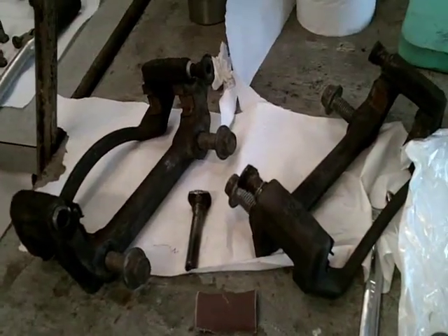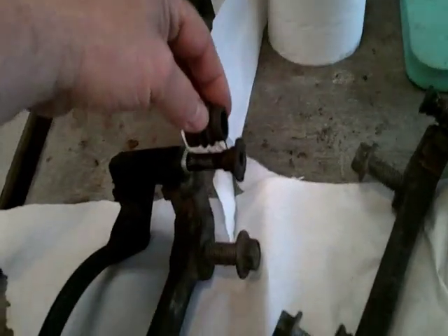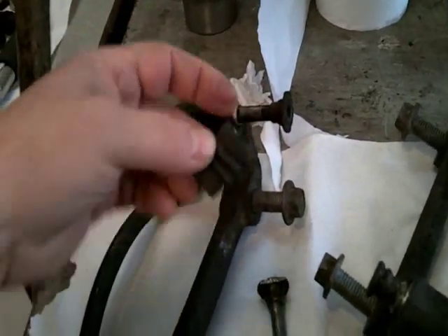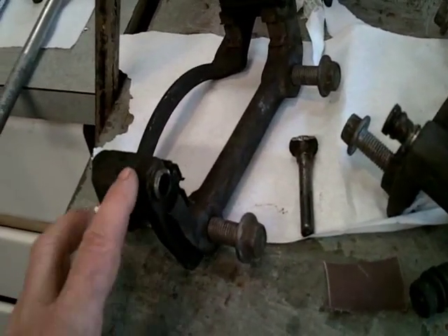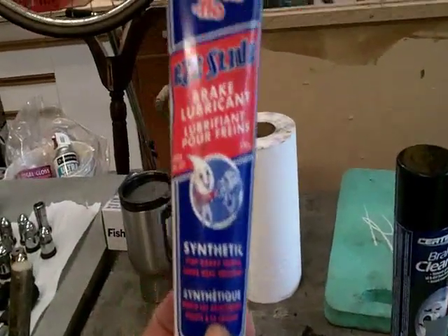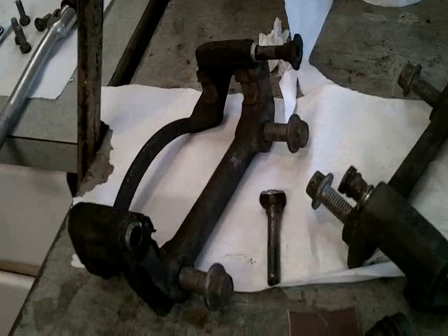There are the calipers. The sliders that the calipers bolt onto go back and forth with a rubber boot that keeps the special grease in and the weather out. One of them had cracked and water had gotten inside — it took me about 40 minutes to free up the pin because they had rusted in there. I've cleaned that all up but decided to get new pins. They come in a set of two, so both will get new pins greased with special brake silicone high-temperature lubricant. I also bought new boots all the way around to keep the water out.